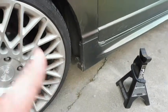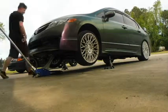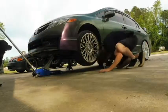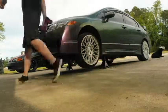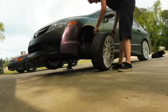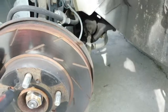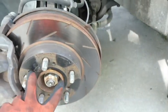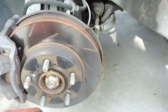So that's obviously the first step — we're going to go ahead and get it jacked up, get it on the jack stands and pull the wheels off. Once we've got the wheels off, typically you'll have a few countersunk screws that actually hold the rotor to the hub. On these Hondas it's usually a pain to get them off and you end up stripping them a lot of times, so usually I won't even put them back in because once you bolt the wheel up the rotors are not going to go anywhere.